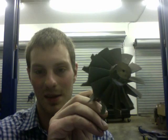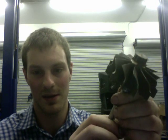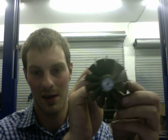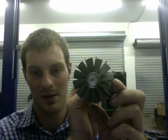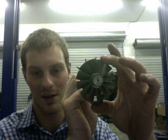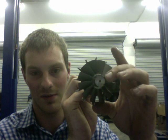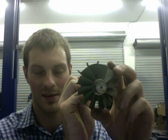That will help especially with the HX40 because you can see how big that nut is. You're also losing a lot of flow with that big nut — you have to think about how much of this shaft dimension is actually flowing air, because the nut takes up about 20 to 30 millimeters, so air is not going to pass through where that nut is.